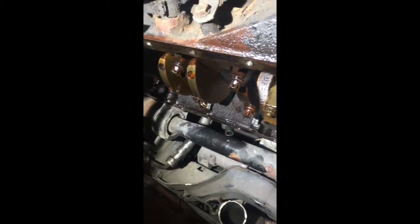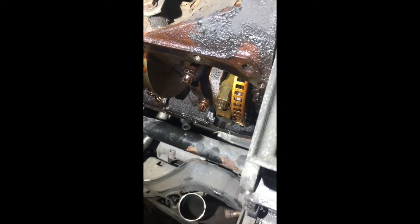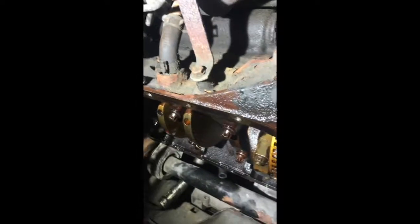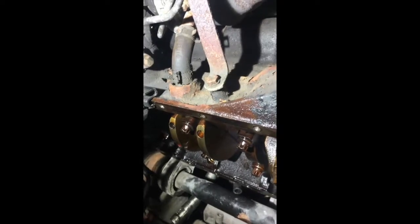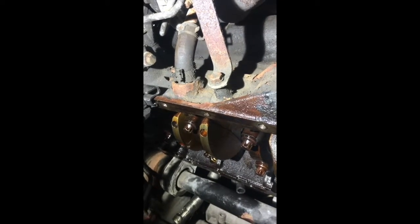So, underneath the engine — I put all the caps back on. There's a cap or two there near the crank sensor wheel. Put all the caps back on so when we do our top dead center for the timing and all that goodiness, we can do it in the right spot, not bend valves — all that good stuff.